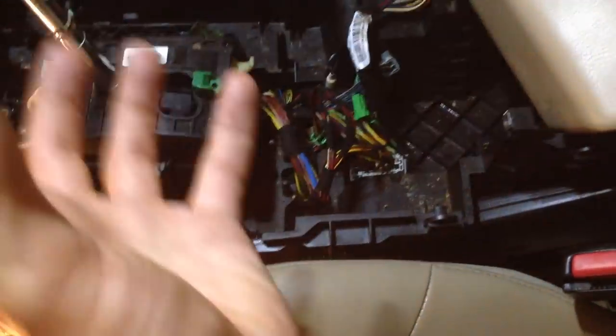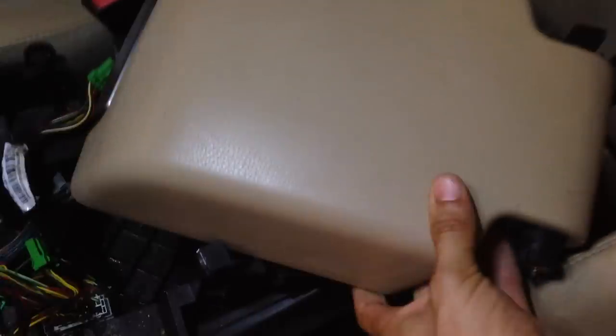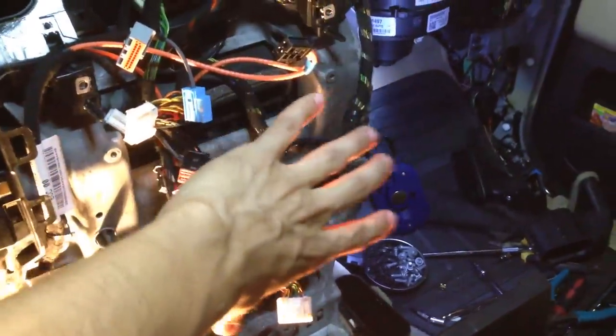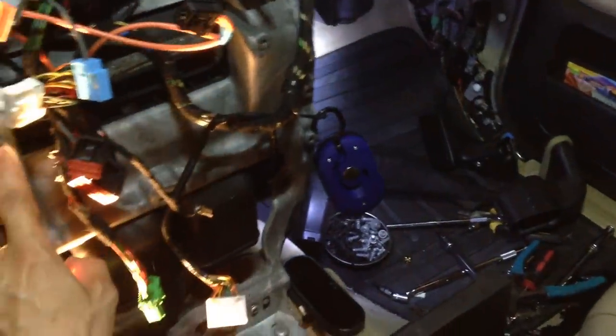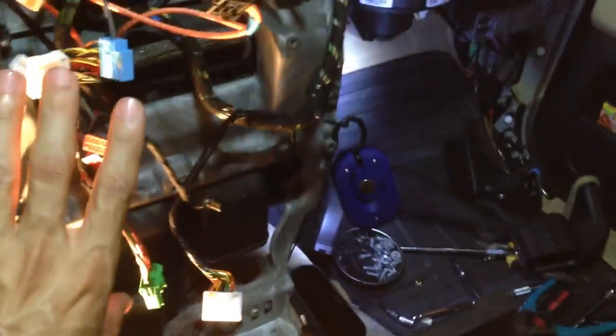You have to take your side fascias off — take this off right here — and the little drawer for the cup holders. Pull that out. This is where your refrigerator is, here's the lid. After you take that off, you have to take off your radio, your air conditioning unit, and your CD player navigation system. After you take those out, there's a sequence of bolts here, here, and here that you have to take out.